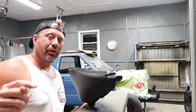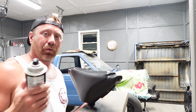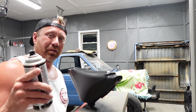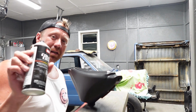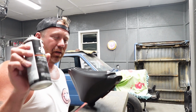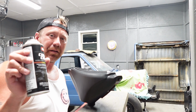Going to add our third and final coat. This will be the last coat to achieve the coverage that we're looking for. And then the last shot is going to be of this whole steering wheel assembled as a whole. I can't wait to see it. I'm excited. But also remember on this stuff, always go on light coats. You don't want to just build. Just go enough to where you're covering what you want to cover. All right, this is a dye, this isn't paint.